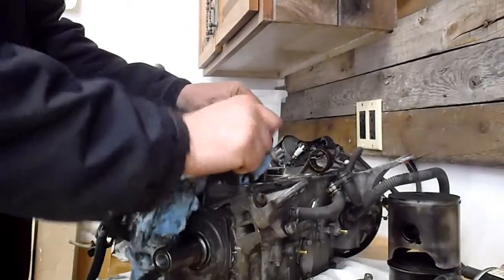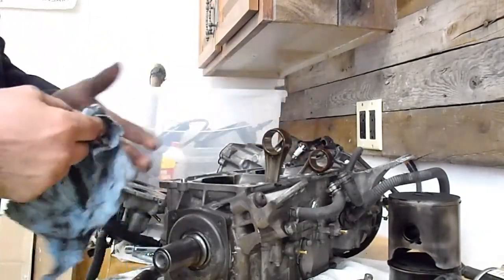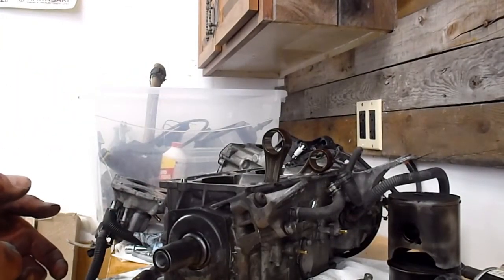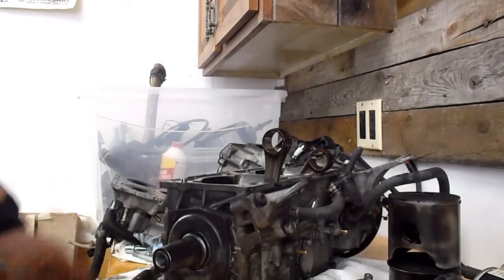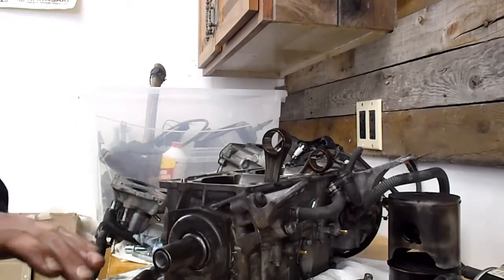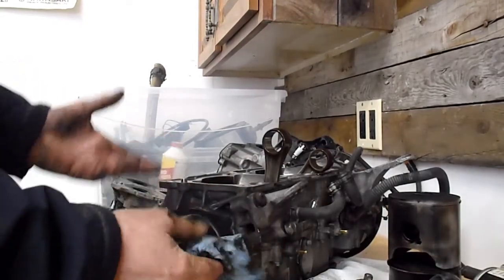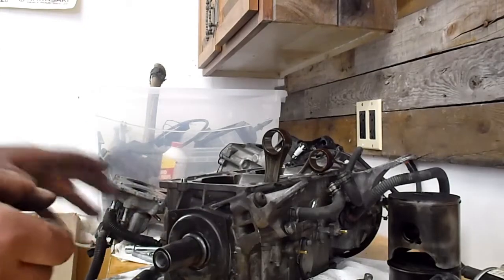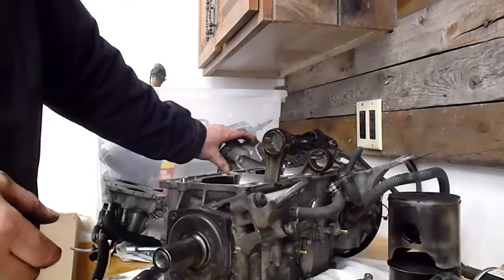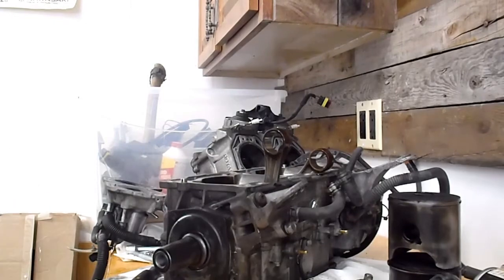The rods are looking in really good condition as well. This crank is probably still good. I don't know what the runout's like — I think I'll check the runout just to see what it's at. The bearings and everything, I think the crank probably could have went further. But when I took this side apart — the PTO side off — because of the bearing spinning on the crank, it should be at least a friction fit on there at the very least. They should be fit a lot tighter than what it was. So I'm not going to take a risk at that. Once you blow a crankshaft it takes out the case, the top end and everything, and then you're looking at another engine.